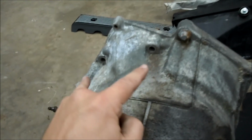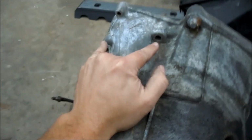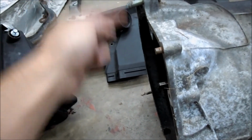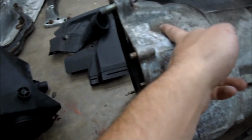So there's 2 of these E-Torx, E10s or E12s that go in and hold the starter here. On the other side, on the motor side over here, there's a nut. And I got this one out by reaching my hand up on the side of the transmission. Well, I can't get a socket or anything to hold this one. So it's just spinning when I turn the bolt over here, which is extraordinarily frustrating. I tried to get my hand in there and just jam a screwdriver into the spot because you can't possibly fit a closed-end wrench around it.